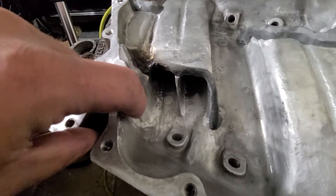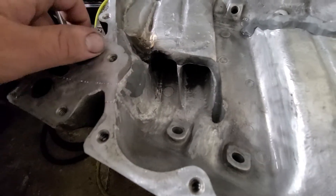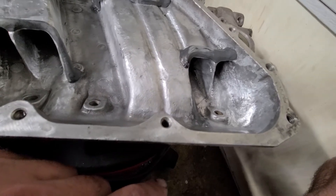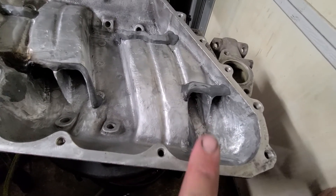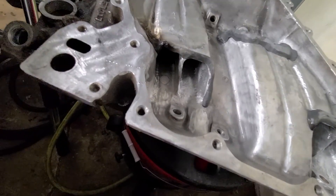This is the only other place I punched through. This is the EGR passage that I don't really care about — I just wanted it to be covered up. I hit the ports with 80 grit just to smooth them all out. Nothing really catches your hand now, it's all nice and smooth. I know it doesn't look it on the camera because the flash is making it look weird, but it is what it is.